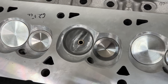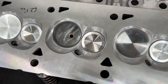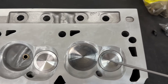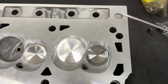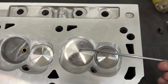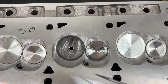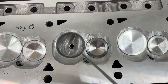It's still a 45-degree valve job - I did not change it to a 50. You might notice these are not in line. Your intake and exhaust valves are twisted - this is like your twisted wedge head, that's what they called it. Trick Flow does have ones that are in line; these just aren't them. People think this swirls more, and I can't wait to show you the results of that - because it doesn't.